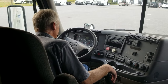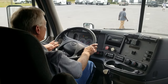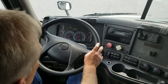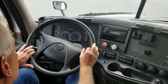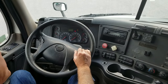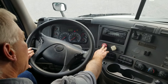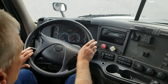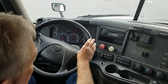From there I'll start my LAP test. I'll turn the engine off, turn the ignition back on but not starting the truck. Make sure both brakes are released. I'm going to sit back and watch my air gauge — I should not lose more than four PSI in one minute with the brake applied. Once I'm satisfied with that, I'm going to check my alarm. My low air warning should come on around 60 PSI. I'll continue fanning it down between 40 and 20 PSI — my tractor protection valve should automatically close, followed by my tractor brakes. And my buttons are working properly. That should end my in-cab inspection.